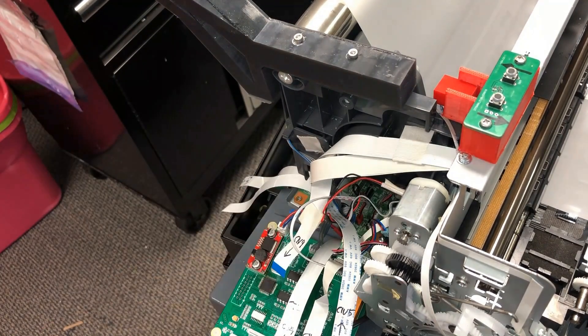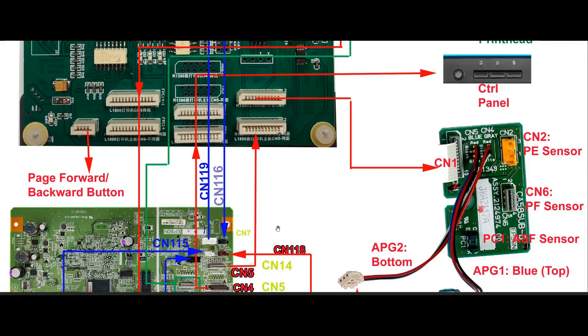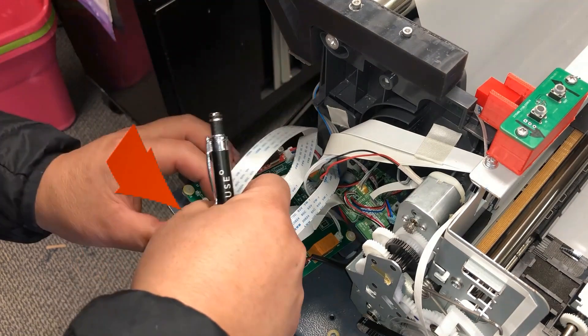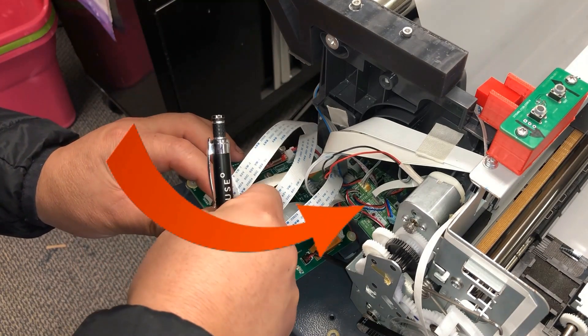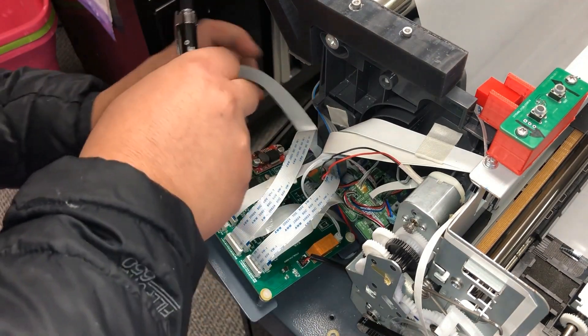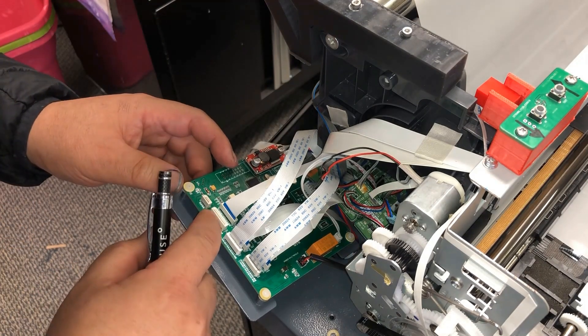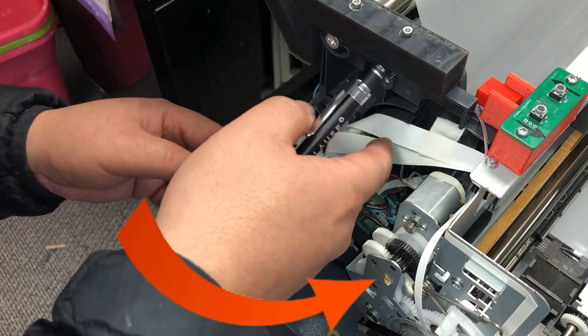Now the last set of cables from this row. This last one — the cable is from the main board CN5, and then connects to CN1 on the subboard. This subboard is normally screwed onto the duplexer of your printer. I noticed there's a blue wire, and here's the APG unit that I'm going to talk about.